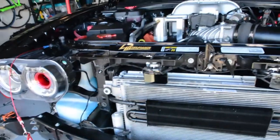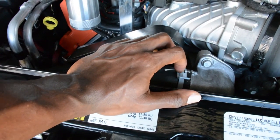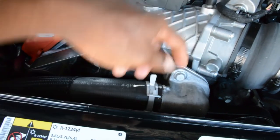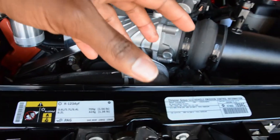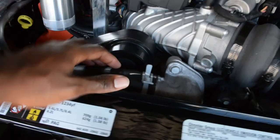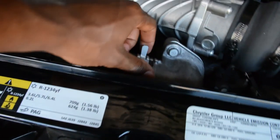I've already started the car and tested to make sure that everything is good. I made sure the T180 thermostat is working properly — I got the engine up to about 176 degrees, and once I hit that the radiator fluid started flowing, the fan turned on, and the engine temperature stayed right at about 176 to 179 degrees. This is working perfectly. I'll post a link to where I got the thermostat below — I think it was about $39 to $40 for the 180 thermostat.